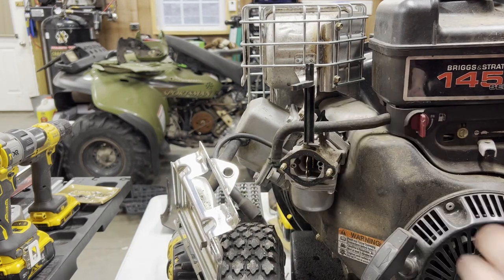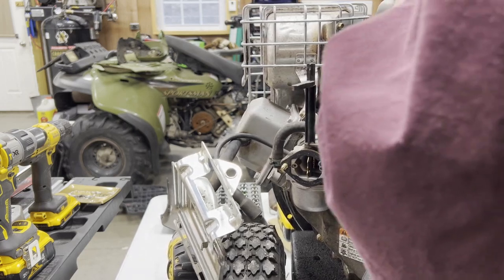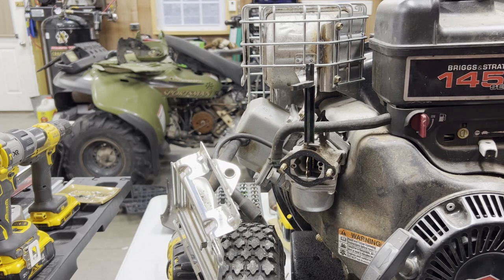I better get something. No doubt in my mind there's gas in this thing. It's going to run out. I put stable in everything, ethanol treatment. I work on a lot of small motors, mostly for my friends or neighbors. And it's always the same thing. Carburetors gummed up. They smell horrendous if they've been sitting for a while. You just take them apart, clean the jets out, clean everything out. I don't even buy new gaskets most of the time, put it back together.